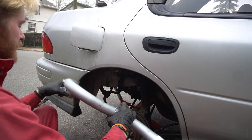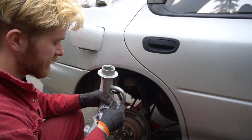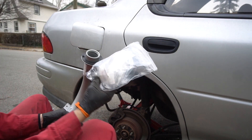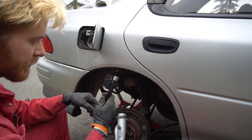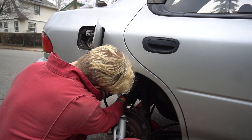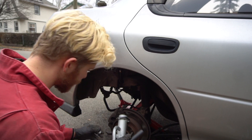First things first, let's put the one-way valve in. Next, the filler gasket — this has two little guide holes so it's going to be facing down, flat spot to flat spot. We got the new hardware — this is nicer because these are hex bolts, not just Phillips like when I was removing it. I'm going to put the fuel filler pipe breather hose through the frame rail and connect it to the other side, which is what one of the new clamps is for. This hose goes on with a new clamp — get it situated.